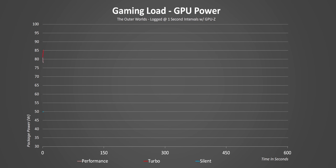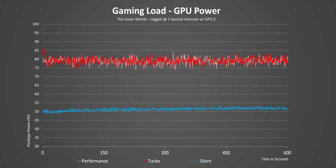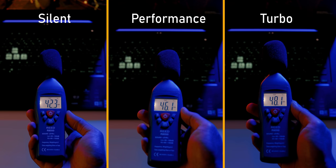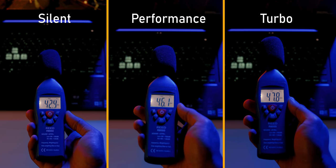Based on the amount of power being sent to the GPU package, it looks like Asus is pushing the RTX 3070 to just 80 watts or even a bit less. That puts it pretty much where the older Max-Q cards bottomed out, which means this is probably going to be one of the lowest-performing RTX 3070s we'll see. Just take that into account when looking at the benchmarks. Noise isn't that bad either, with all modes staying under the 50 decibel mark, and it's pretty obvious Asus is sacrificing some top-end performance to reduce that.